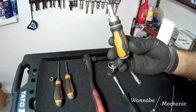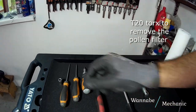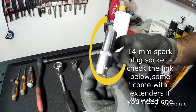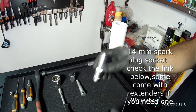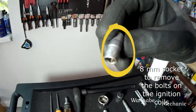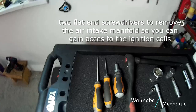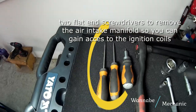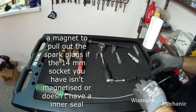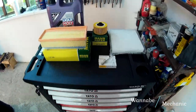A T20 Torx to remove the pollen filter, a 14mm spark plug socket. Check the link below, some come with extenders if you need one. An 8mm socket to remove the bolts on the ignition coils. Two flat end screwdrivers to remove the air intake manifold so you can gain access to the ignition coils. And a magnet to pull out the spark plugs if the 14mm socket you have isn't magnetized or doesn't have an inner seal.